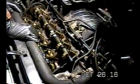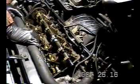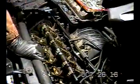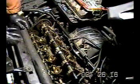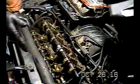That's true. I'm working in my garage right now. It's late at night. I don't want to drain this thing in my garage. I'd rather do it outside tomorrow. But if you wanted, you could drain that first, and it would give you more room in this area to do your work to get these bolts off, because you're going to eventually have to remove this anyway. So again, if you want, and if you've got the time, if you're outside, go ahead and just drain everything, get the cooling fans out, and take the radiator out anyway.